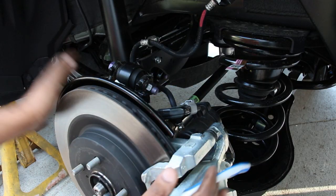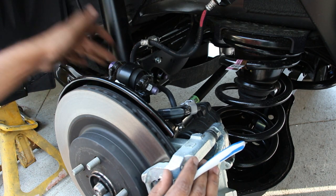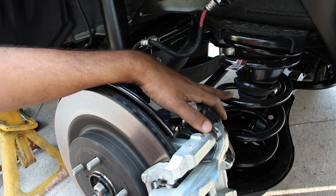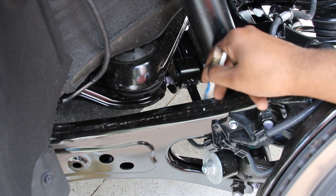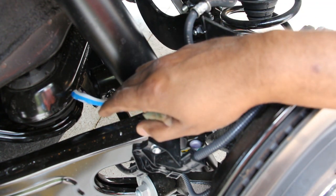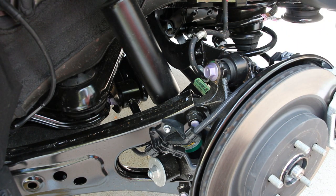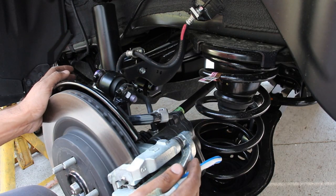Now taking a look at the Highlander's rear suspension, we've got a multi-link suspension design. There's a shock absorber located over here that bolts directly to the knuckle. You've got an upper control arm here and then a rear lower control arm over here that carries the weight of the spring. Down around this side you've got a rather large trailing arm and then a front upper control arm that ties into the knuckle. I think Toyota has done a little bit of cost cutting back here because there's absolutely no aluminum — everything here is made of steel including the knuckles and even the subframe. Multi-link suspension design has become commonplace on a lot of midsize SUVs like this one because of its good handling characteristics, though some brands have executed it a lot better, making it easier to work on given how complex the design is.